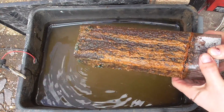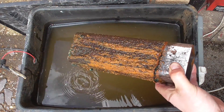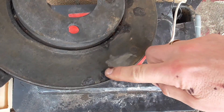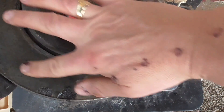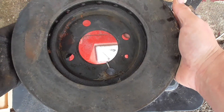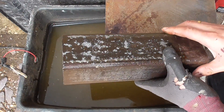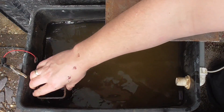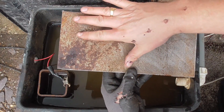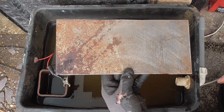I imagine quite a lot has come out from between the vents on the disc. I'll give it a quick clean — just wiped with a rag and that's the finish. The bit I cleaned with emery paper, and the bit that was cleaned by the electrolysis — it's left it a dull metal but it does look pretty clean. On the back, the sludge scraped off really easily, then I hit it quickly with sandpaper to give it a bare surface again for good contact. So we've got surface rust here and some heavier pitted rust, and I'm curious to see how much more it'll actually get off.